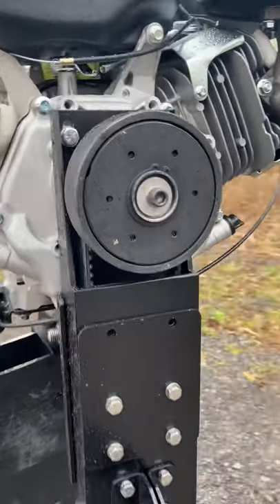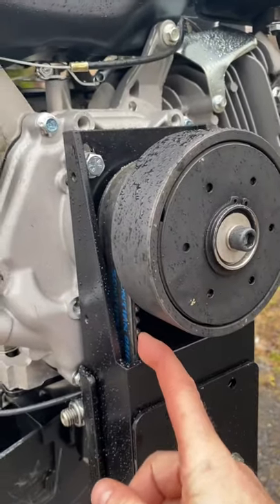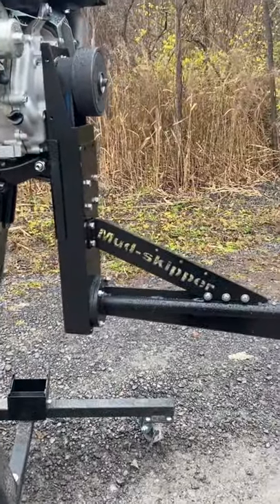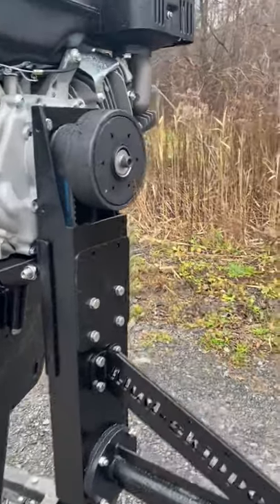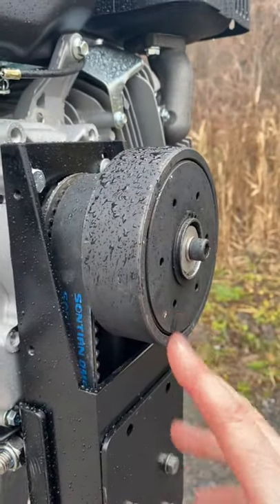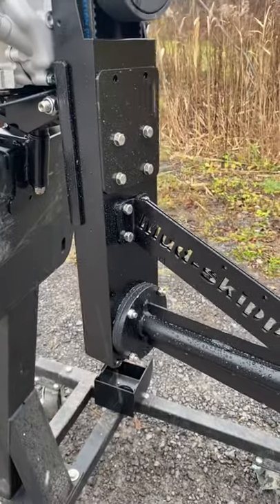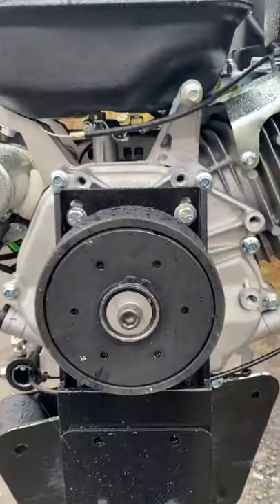This is the mechanism and driveshaft for the 13 light. It's driven by a synchronous belt, so it's a lot lighter. This kit retails for $999, so it is $100 more than the SD300, but in our opinion worth absolutely every penny. The number one feature of this kit is it uses an inertial clutch, so there's a neutral gear. When you start your engine, your propeller is not automatically spinning. This kit also has a one-to-one gear ratio.